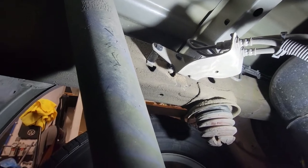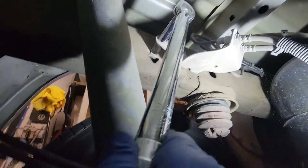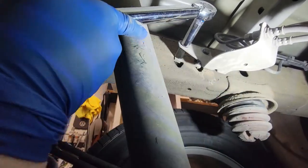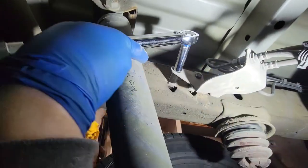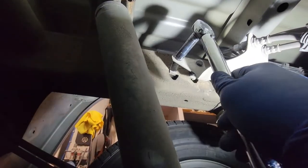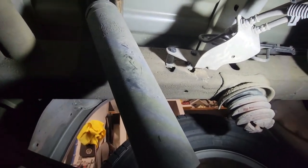All right, these brake brackets want to be torqued to 10 foot-pounds. So I got my torque wrench set at 10 foot-pounds. There's little flimsy washers back there, so I think my impact might've stripped them out. I don't want to do that, so I'm going to follow the instructions. Really difficult to do while trying to hold a phone, but you get the idea. Just 10 pounds on both of those till it clicks.